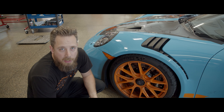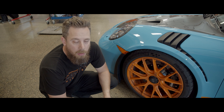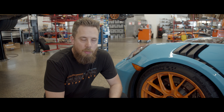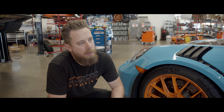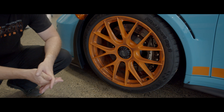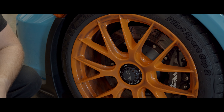AP Racing 500 kit. So that will be up on our website. Fantastic option — this also gives us the ability to run a smaller diameter wheel. We've got guys running down to the 19s. You will have to shave part of the toe rod bolt on the bottom, but it's all doable. That will open you up to different sized slicks, race tires, race compounds, all kinds of different stuff. It also gives you a little bit different gearing — some people like it, some people don't, so it's preferential.